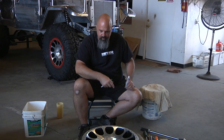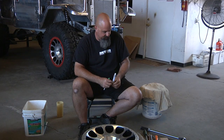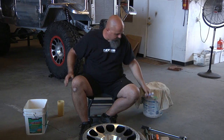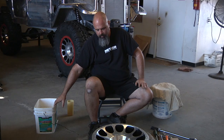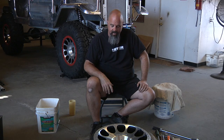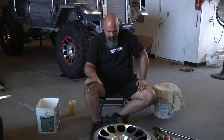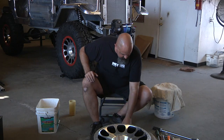If they gall the threads, you're done — dead in the water. So you don't want to ruin a $500 wheel by just not having anti-seize. Next thing, most important probably, is soapy water. Don't use anything that can stay in there like grease, oil, or WD-40. You don't want anything that will keep the wheel slippery. The soapy water goes on the wheel, and once you're done it dries up real quick, especially on a hot day. Anything you get on your wheel washes off. So what we're going to do is soap the wheel up, jump up and down on that tire, get it on, and then get this thing torqued up.